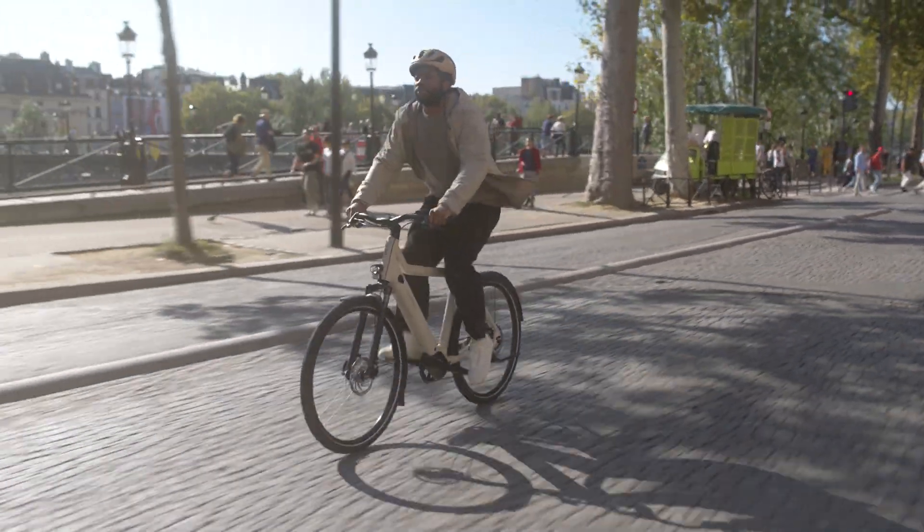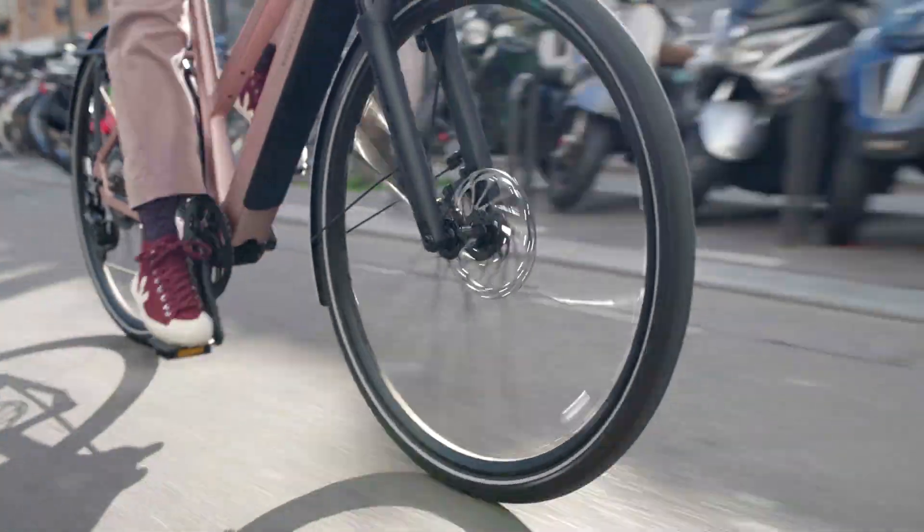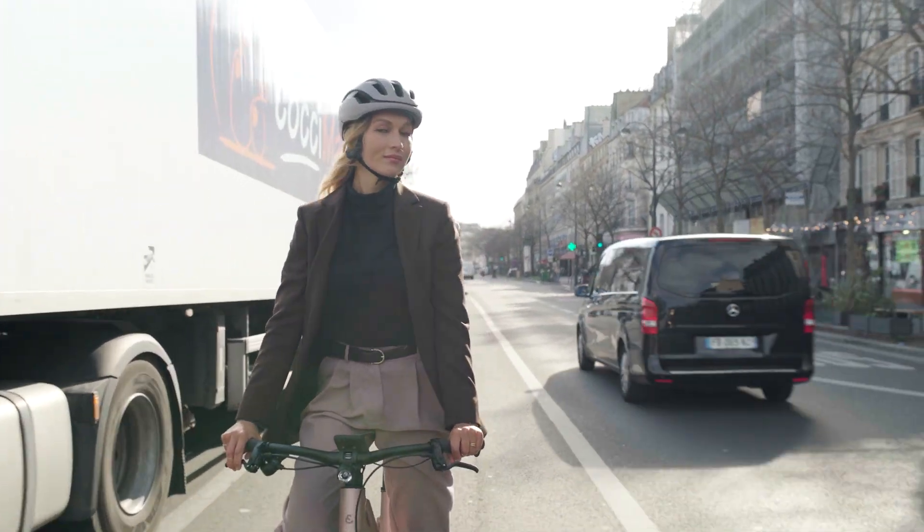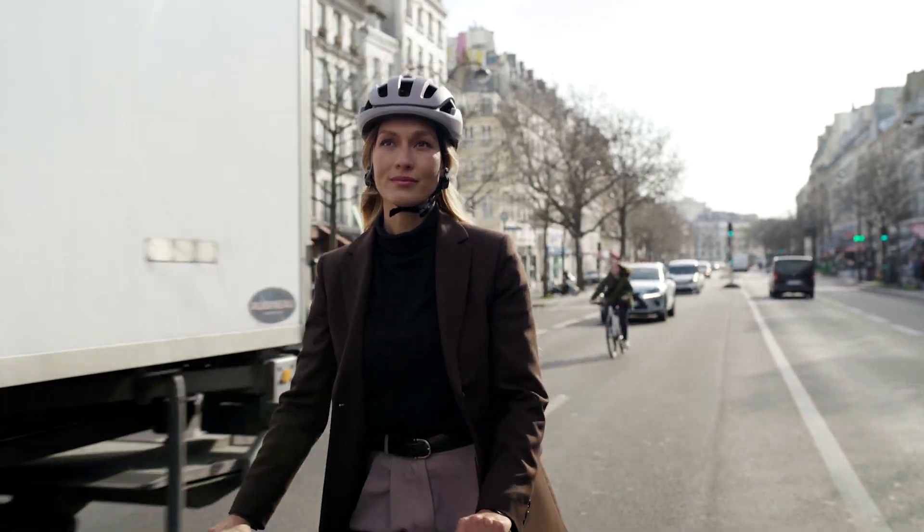You are driving a car and roll up to the traffic lights in a high gear, disengage the clutch, shift into first and drive off again. You would not drive off in third or fourth gear because that would cost a lot of energy and put undue strain on the clutch and gearbox. Unfortunately, this is exactly what happens to many e-bike users. The powerful motor and the various support levels make it possible to ride in a gear that is set too high, which leads to rapid wear and higher energy consumption. It is therefore advisable to shift into the starting gear in good time before stopping when using derailleur gears.